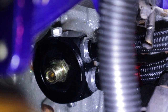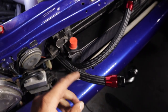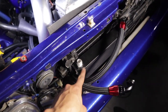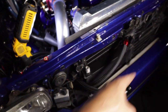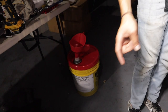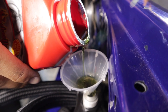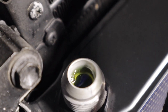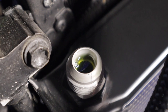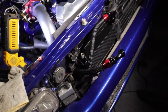The sandwich plate has the two lines and everything on, and I tightened down all the fittings. I still need to tighten down where the oil filter goes. Before I put that fitting on, I'm going to fill up the oil cooler with oil first — because before you turn on your vehicle, you want to make sure there's oil inside of there, since you're going to lose oil pressure due to the pump trying to push oil through the cooler. I had to transfer oil from a five-gallon drum into a small bottle to pour it in. The oil is all the way up now, and I let it sit so all the air got out. Now I'm ready to put the line in and make these lines look clean.